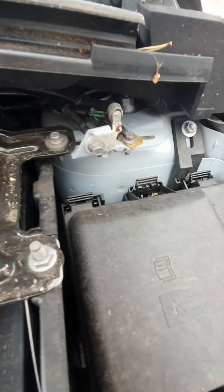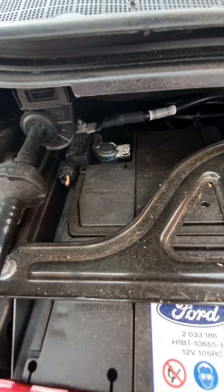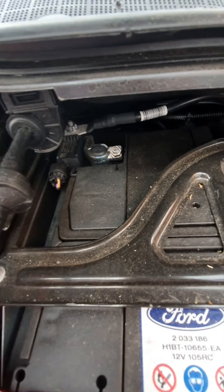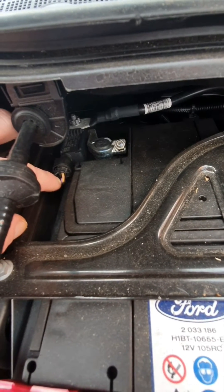You can see the cable running along there — that is a chassis ground. You can also see here a little plug connector. This connector connects to the battery junction box through a fuse to the battery positive post via the yellow and violet wire, and to the BCM via a LIN bus through the violet and white wire.